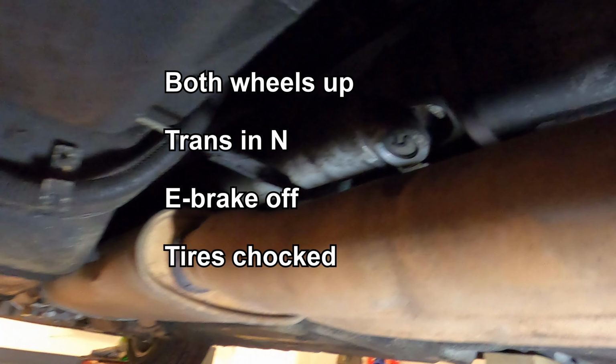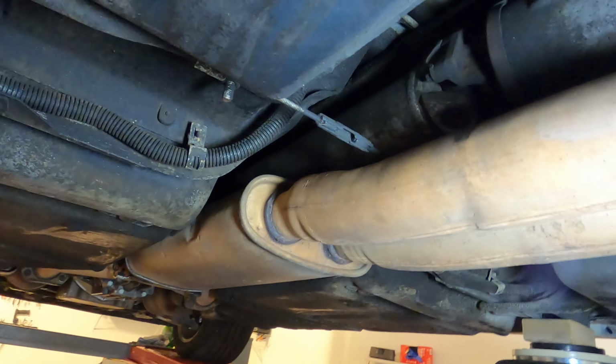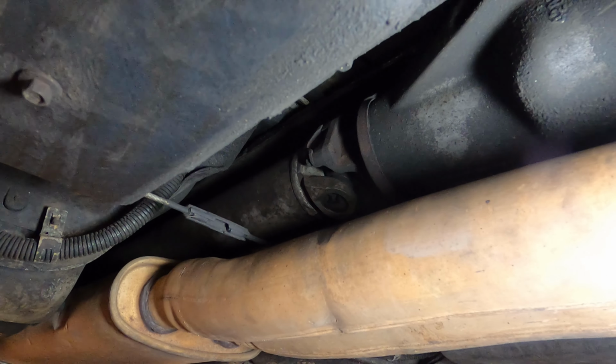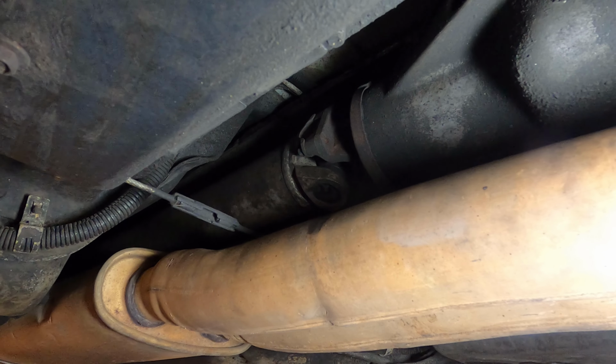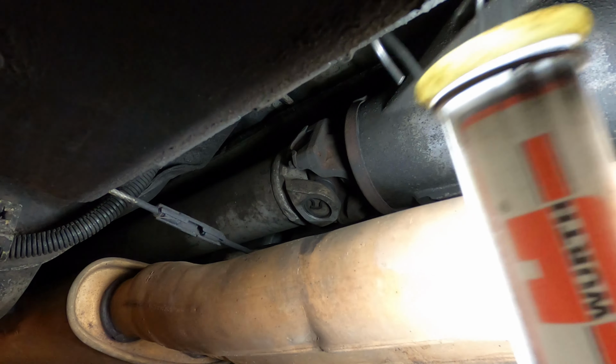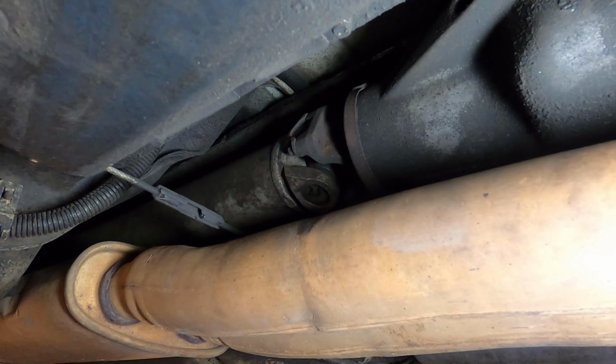So we're gonna do one full rotation of the wheel and see how many times that drive shaft spins. If it spins roughly 3.5 times, that would indicate 345 gears, stock gears for these LT5 ZR1 cars. If it turns a little over 4, that means somebody's gone inside here and changed the gears out to 410s. So we're gonna find out which of the YouTube commenters is correct here.